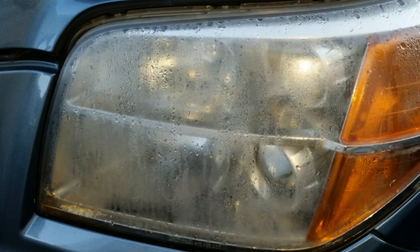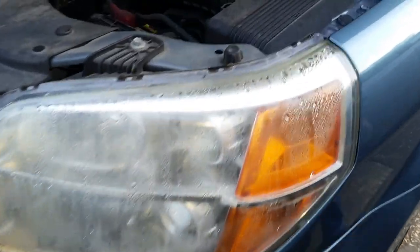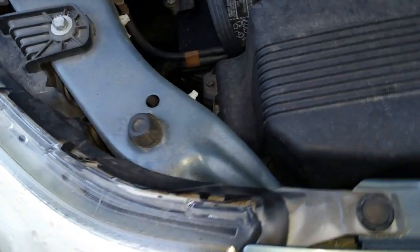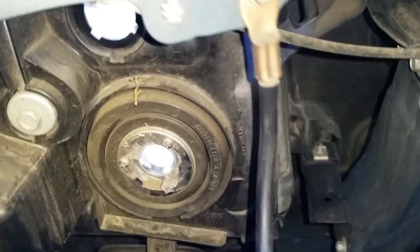Another problem that comes up with plastic headlights is water getting inside the headlight. The best way I found to correct this is to remove the headlight and dry it out, then seal it up. But the process to remove some headlights requires removing more parts than time will allow, so in this case I did the drying while the headlight was still mounted in the car. To do this I located and removed most of the light bulbs from the headlight — in this case I removed three of the bulbs.